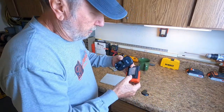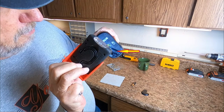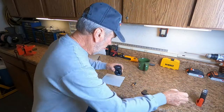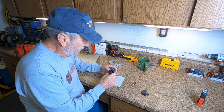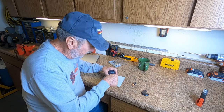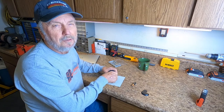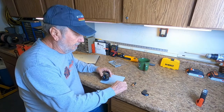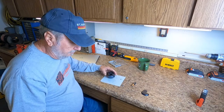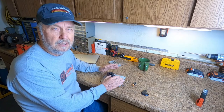Let me use my flashlight so you can really see it — it's right next to the plus sign there. Now I'm going to put the screwdriver in there. I have something down here to protect the bottom from getting scratched. Apply gentle pressure down, then unscrew it. The screwdriver may be magnetic so the screw will stick — be careful not to drop it on the floor or carpet. Do this over a dining room table with a towel out so you won't lose the screw.